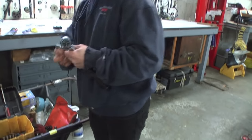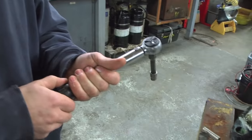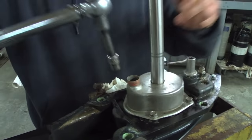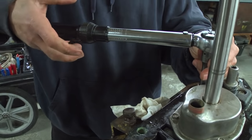I like to put a little dab of grease on the bolts so they come out easier next time. Get them all greased up, set them aside, and get them just hand-tight — not too crazy. Now we're going to torque these down to 60 inch-pounds, as confirmed in the manual, using a crisscross pattern to tighten them all down equally.